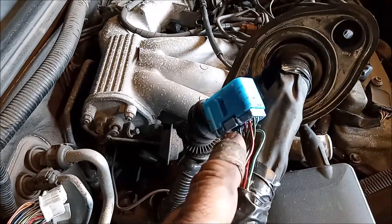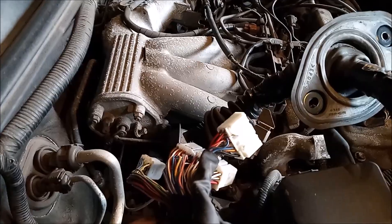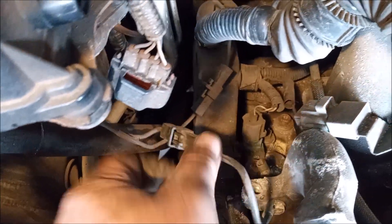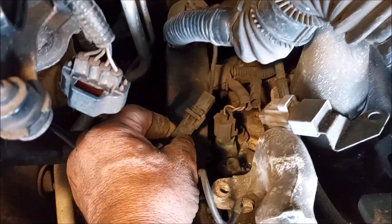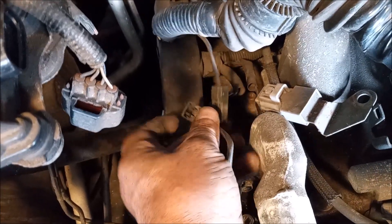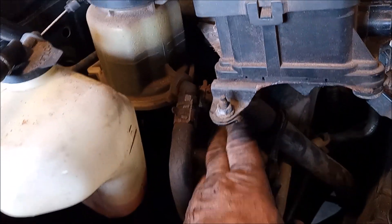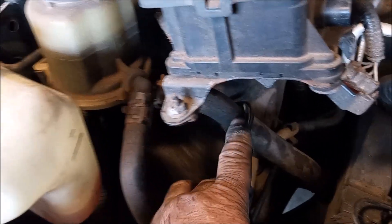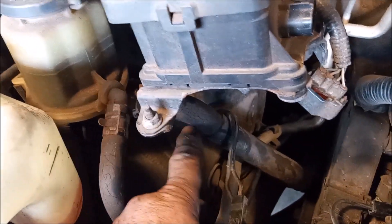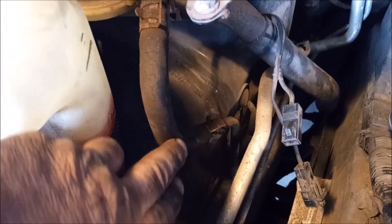So you have to get it from inside the cabin. You have to reach way back and line this up with the hole. And here's the rest of the harness. We have two ground wires here — they have just pop connectors. We pop them out, and they're both out. Tuck them away. Power steering reservoir is right here and this connects to the pump.